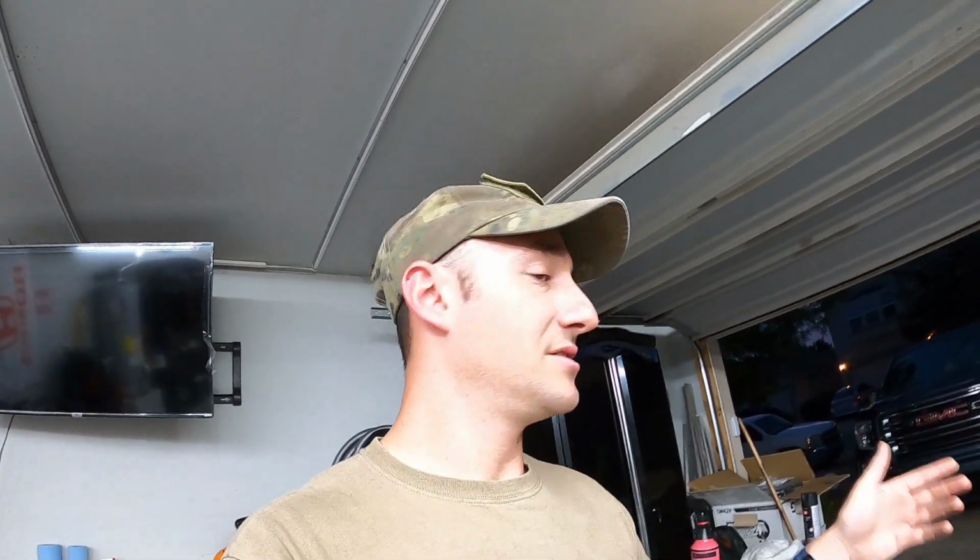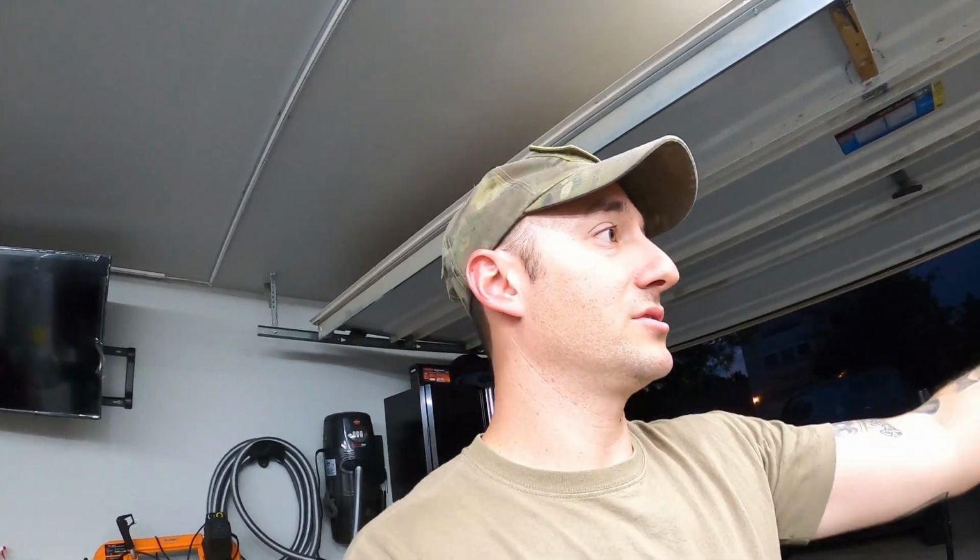So I'm thinking of taking the doors off, taking the sunroof off, taking the bumpers off, fenders, hood, whatever, and throwing just the body itself over, paint the rear quarters, paint the pillars and the roof, and then roll it back into the spot that it sits, and let it cure for a day or whatever. And then slowly, you know, hang my little paint booth area and do, say, the doors, and put the doors on the next day, and then do the fenders and the bumpers, do it like that in pieces.